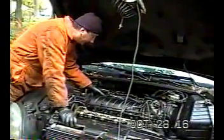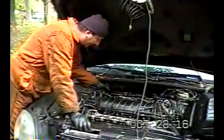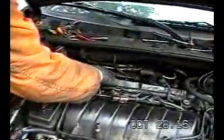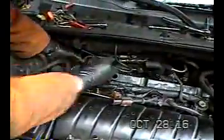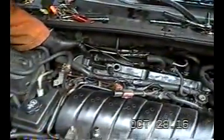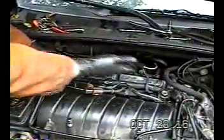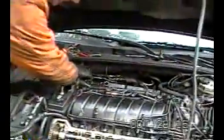Okay. All right, I took out all the bolts. The reason I'm showing you this right now is this thing, and I know this from experience. I've done this once before. This valve cover will not come out. You just don't have the room. It's got to lift over the sprockets here, and it's got to come out. Luckily, there's no camshaft like you had over here that you have to pull it through. But there's just not enough room.